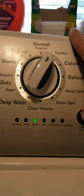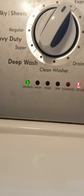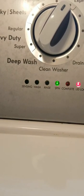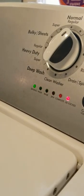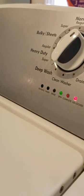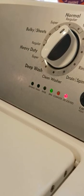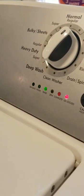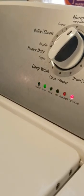The first light — when you turn the knob after all the lights are blinking — lets you get to different selections. The first selection is your error code; you could push Start and read error codes. We're not going to deal with that. The second one is automatic diagnostics — press Start and it goes through a series of trying out different loads in the machine to find a malfunction. The next one is manual diagnostics — push Start and turn the knob to select which loads you want to try. We'll do that in a minute for spin.